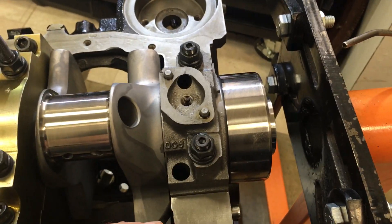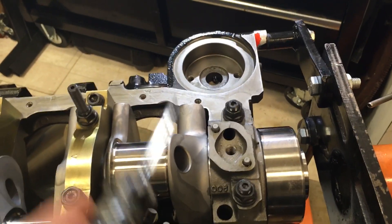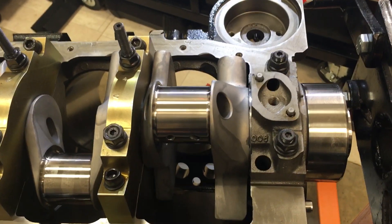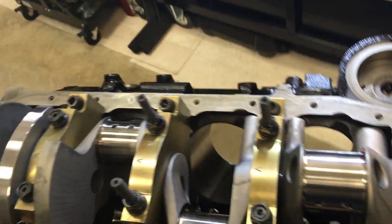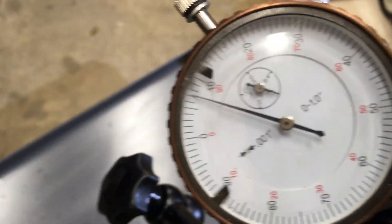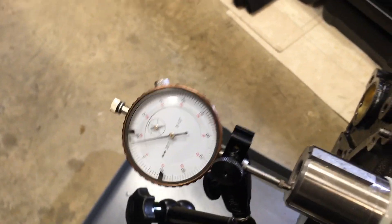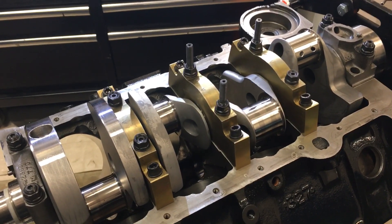You could say that you're done, but you want to double check that the bearing halves are flat and even. The only way to know that is to measure thrust — is thrust the same as when you used a feeler gauge? So you push the crankshaft forward and get your zero, that's one thou right there. Then you push it the other way and I get a seven, so we have a thrust of six — and that's what my feeler gauge measured. 399 race shop.